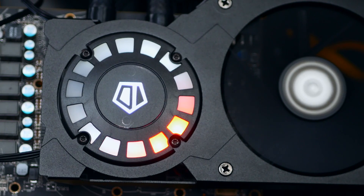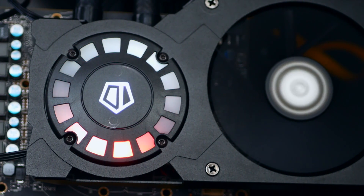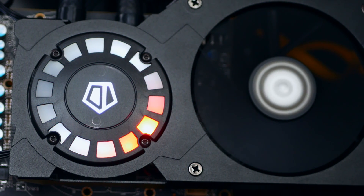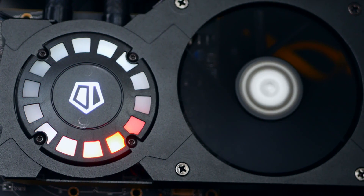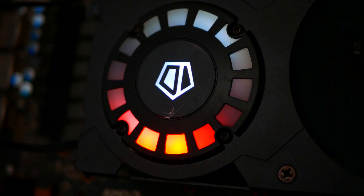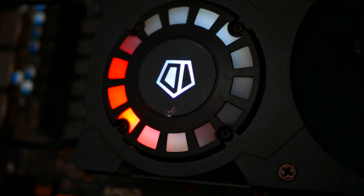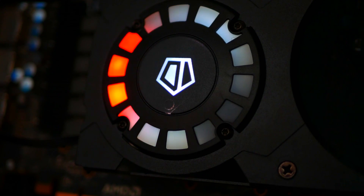The process of building this thing was actually very pleasant and I am happy with how it turned out. It looks absolutely outstanding and is a huge step compared to the stock blower — quieter, cooler, and in a 25°C ambient it is never above 48°C even at 1500+ MHz. The cooler also has some type of lighting on the pump unit called Comet: white lights with a red circling tail that looks actually pretty cool and matched the theme perfectly. The footage doesn't do it justice as it looks much better in person.